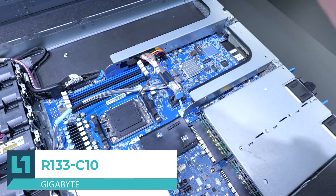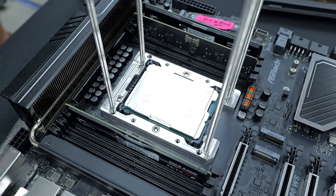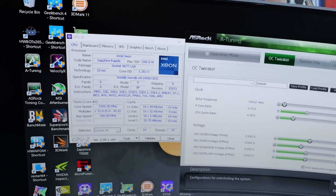I was also really excited that we're seeing a lot of AM5 server platform stuff, so maybe I can have a 7900 non-X for my home server. For me, this was eye-opening in seeing the HEDT — I didn't even know it really existed in this form, but now it exists as Xeons and W790 motherboards. I was always focused on the 3900X and the 7950X, so I'm actually going to be branching out now and looking at both these options from AMD and Intel. The weirdest thing is they've kind of given up on X299's successor and AMD's kind of given up on Threadripper's successor — it's server-grade stuff now. Splave called our 16-core overclockable monster 'Server Lite,' and I think that's a pretty good description. Four DDR5 memory channels, requires registered error-correcting memory, but with that you get two-terabyte memory capacities. I'm really surprised that Intel has been so conservative with this platform in terms of marketing.